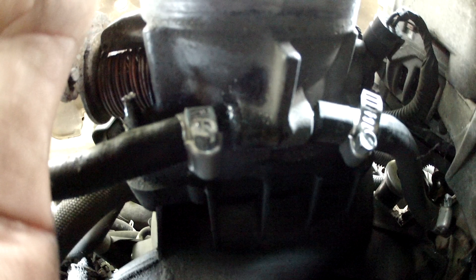I've seen a coolant leak here in Chevy trucks before. It's worth checking out if you've got unexplained loss of coolant, especially if you're suspicious of the water pump gasket. These hose connections at the throttle body aren't even mentioned in the dealer repair manual. I assume they're there to allow trapped air pockets a shortcut pathway back to the radiator, but I'm not certain.